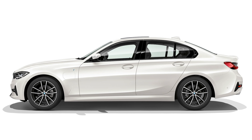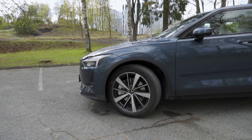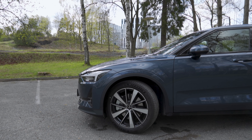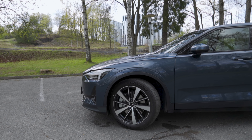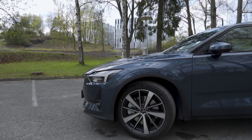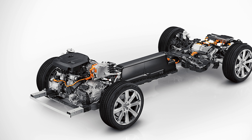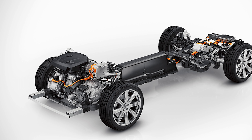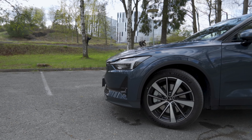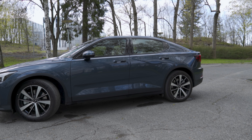So if you look at something like a BMW 3 Series or Mercedes-Benz C-Class, the room between the front wheel and the front door will be greater because the front wheel is pushed forward, because you don't have to accommodate for the drive wheels typically on a platform like that. A front-wheel drive platform is a bit different because it's meant to have the engine in front of the front wheels, and often the transmission either on one side of the engine, in front of the axle, or even in front of the engine again.